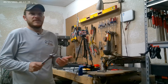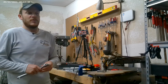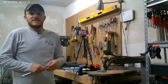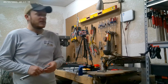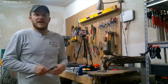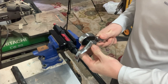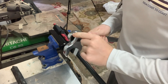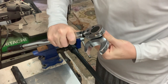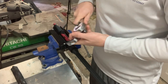They did say it was good for about 30 to 80 foot pounds of torque and recommended using a basic crescent wrench. It's not really the way I would want to do this, but I don't think I have another option. From my research, and from what the guys at F1 said, you're really probably not going to under-torque it and it's pretty hard to over-torque it — just put some moderate pressure into it. For those who can torque it down, a tip: when you put it on your torque wrench, you need to be at 90 degrees. You don't want to be angled — you want to start at 90 degrees from the torque wrench.